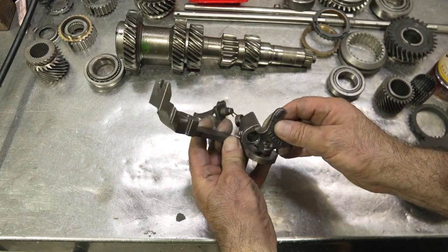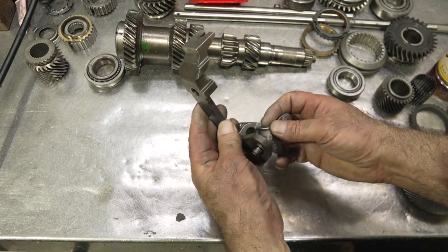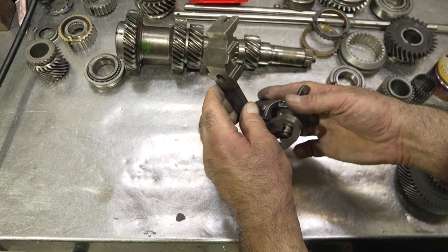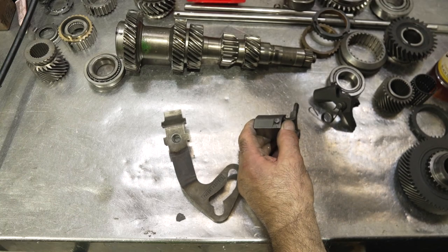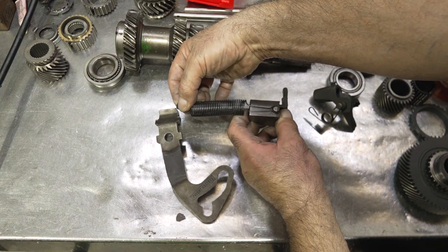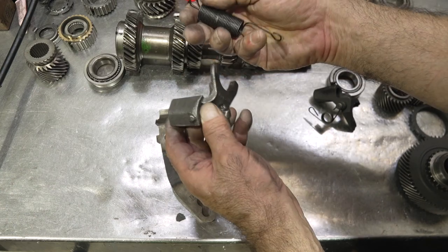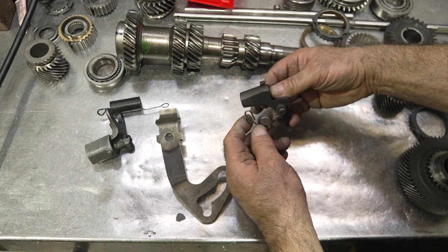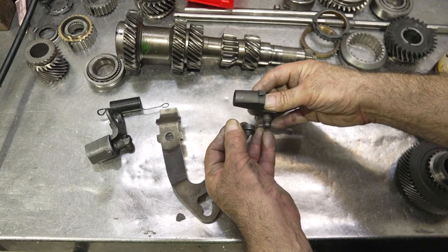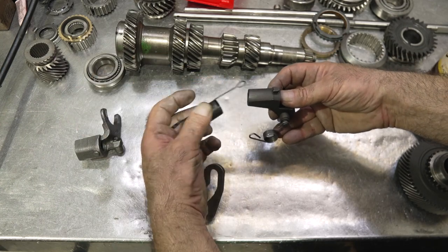The reverse fork and arm must match — you can't change from one to the other. The non-reverse-brake fifth-reverse fork works with a spring going to the front of the case, while the reverse brake version fits inside the case with the rail going through it. When you have a reverse brake setup, there's a wrap spring inside the case that goes to a stud cast into the case. Always use the non-reverse-brake setup if you have it — it's the better option.